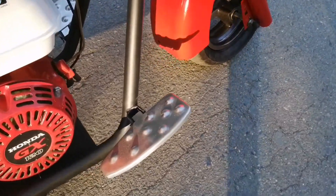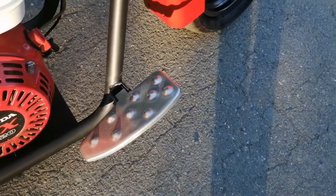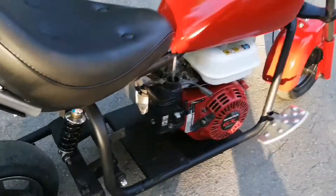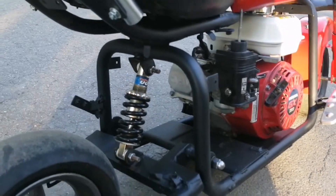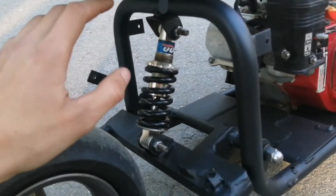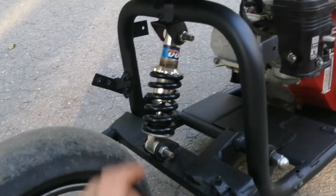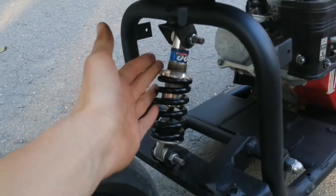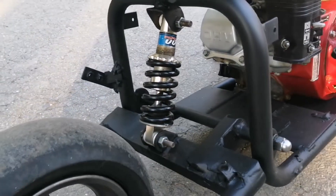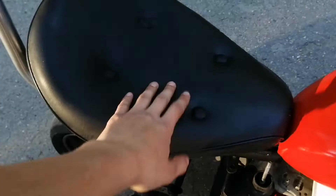It has some little platform foot pegs which are going to be really comfortable compared to a normal pocket bike foot peg, especially for this style frame. The rear shock was another thing I had to sort out — it didn't have a rear shock when I got it and there was some weird welding going on. This one is off a generic Walmart bike and I went ahead and set the preload quite stiff, and it works out great for this mini bike frame.